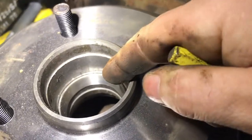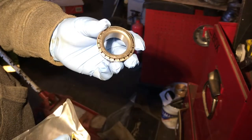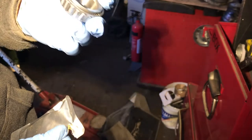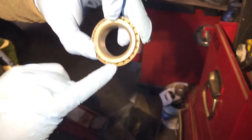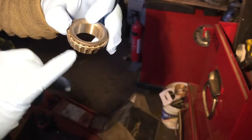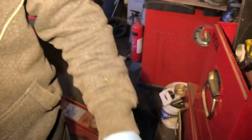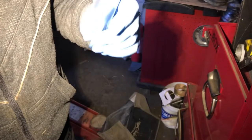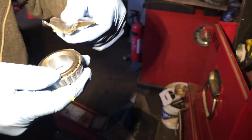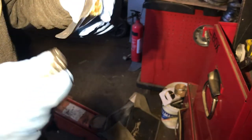The next job is to get the bearings and pack them with grease. The most important thing is that we pack the bearing correctly — you don't just smear grease on the outside. We want to get grease down into the little grooves in between all the rollers. When the grease is coming out at the top and the bottom, it's correctly packed. Normally I use lithium grease, the blue grease, but since the kit came with grease, we'll use that.